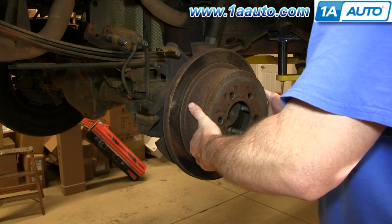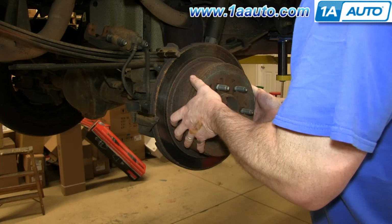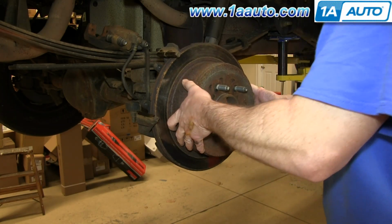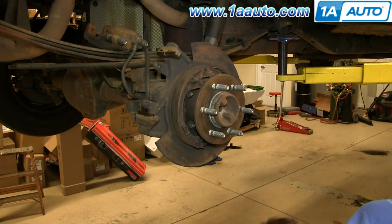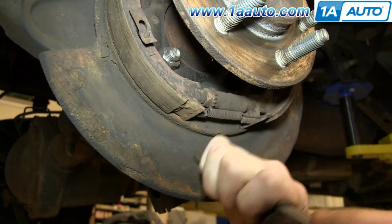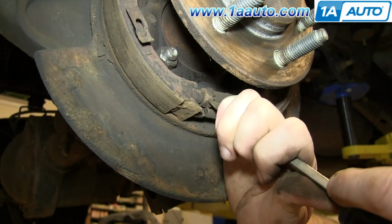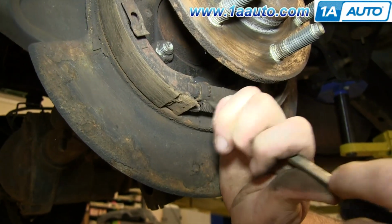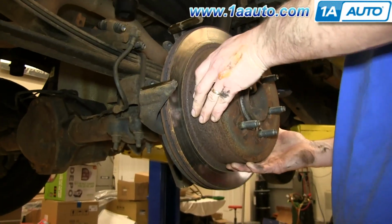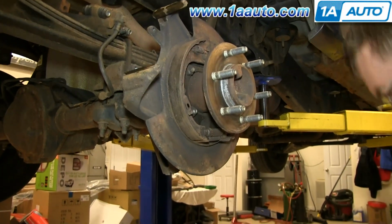And when you put the rotor on, it should go on. You want a little bit of contact from the emergency brake shoes, and you can see there's a lot of play. So we're going to adjust the emergency brake shoes. On this side we're going to go down, and it's exposing more thread, so that means it's pushing the emergency brake shoes out. Rotor. Still quite a bit of play, so we'll continue to adjust it.